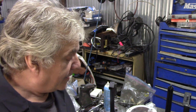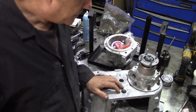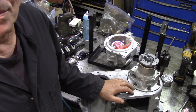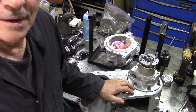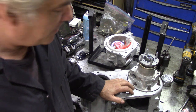The Disco 2 relied on traction control for its four-wheel drive management, and the diff lock sort of became obsolete. Not that many people actually used the diff lock — they didn't even know the thing was there half the time. Most of the Disco 1s I've had in here, all the linkages were seized up because nobody knew what they did. So I'm going to build this transfer box up and make the ultimate box — working out modifications with JP and others to make them last a bit longer and be more reliable.